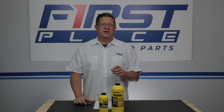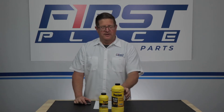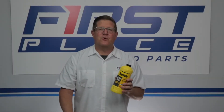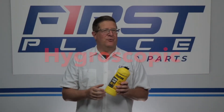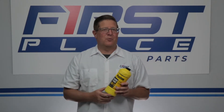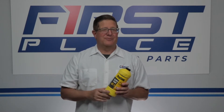The Department of Transportation ranks brake fluid in classifications. The DOT part on the label stands for the Department of Transportation. DOT 3 and DOT 4 brake fluid is amber in color, kind of like your favorite light beer, and by nature is what science likes to call hygroscopic. You and I would just say that it likes to absorb water from the air, which ultimately is going to affect its boiling point.